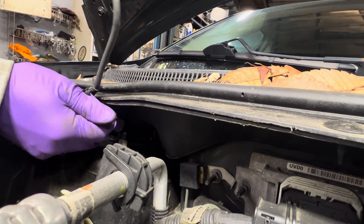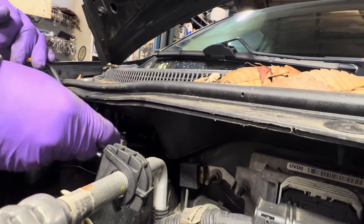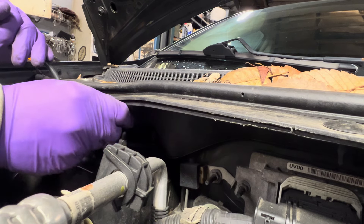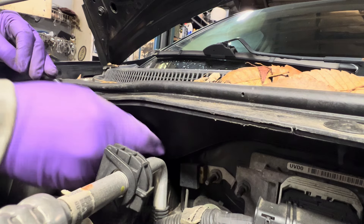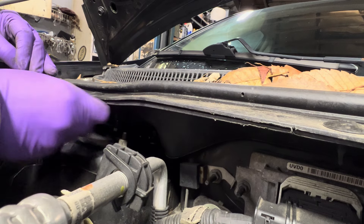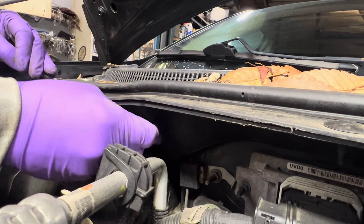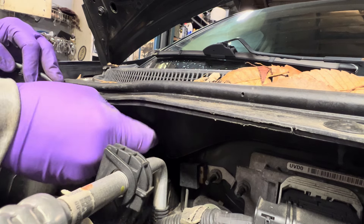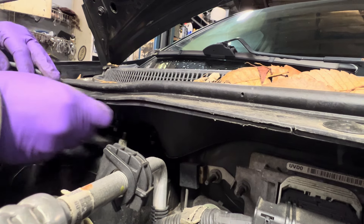We're going to give this a go. We got a boxed-in ratchet wrench on the other end. I'm going to take the back two bolts that are a nightmare out first. The reason I'm taking them out first is because the front two bolts will hold the strut in place and you won't be fighting with it. But when we go back in, we're going to want to put them in first, only because the threaded part won't be jammed through and touching the wiper cowl.